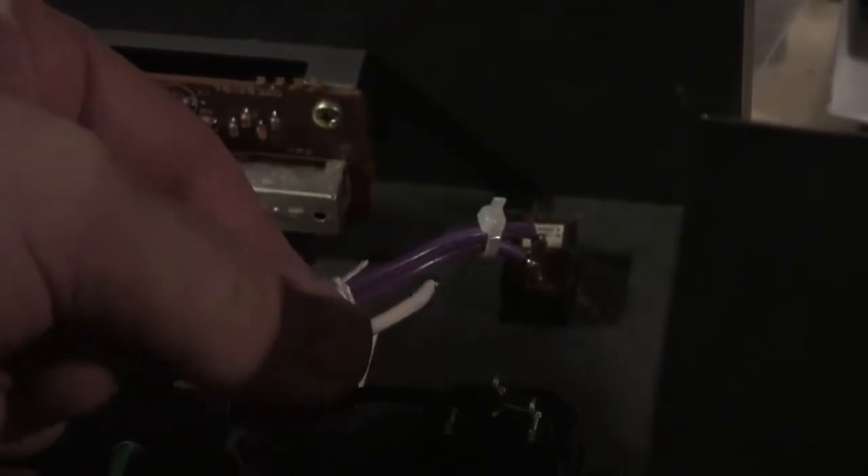So this one's going to go over here on this side. This is actually a nice wire, it's already color-coded. Does it matter which one goes where? It actually doesn't, because this is AC — alternating current — so the black and white don't have the same polarity rules as DC, where you really do have to get them right otherwise you wreck the whole thing when you power it up.